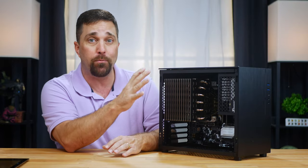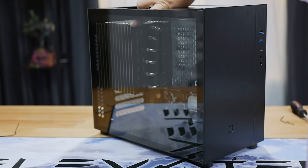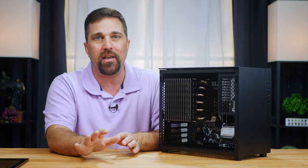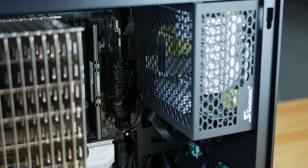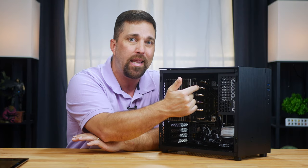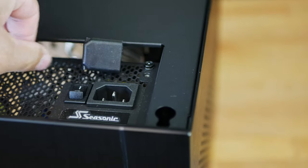First, and most importantly, everything, including the NH-P1, fit in the case. I mean, just barely fit. There's only a few millimeters between the heatsink and glass, but it fit. No problems with the full ATX power supply in the case, but if you're using this case, you'll need to plug the case power extension cord in before you screw the PSU in, because once it's mounted, the cable won't fit through the pass-through for it.